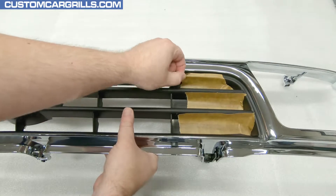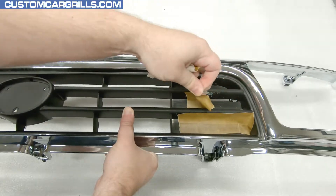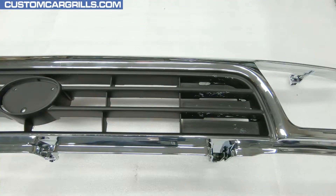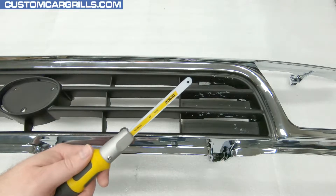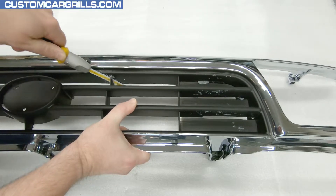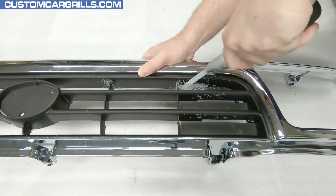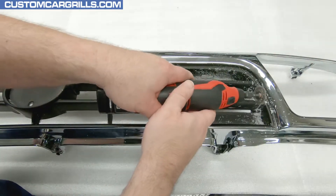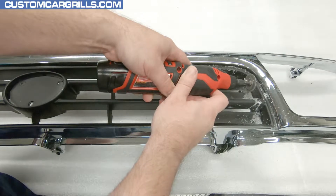While that's hardening, I'll remove the tape from the front of the grill. It's a good thing that was there — I can see a lot of repair material that would have spilled through. Now it's time to cut out the center section, and to do that, I like to use an open-ended saw blade like this one. This will make short work of the thin vertical support bars. It's also good for getting the side areas started on too. I probably overfilled the bars with repair material a little too much, so cutting into those bars is easier with the rotary tool.